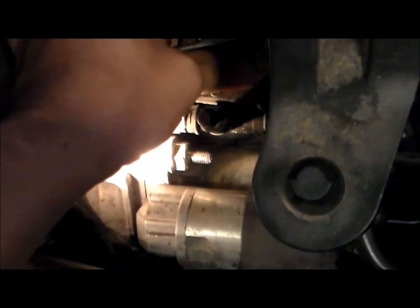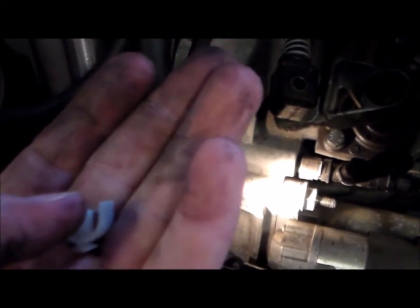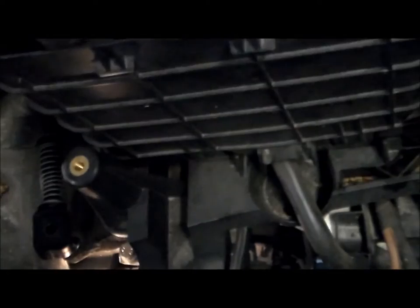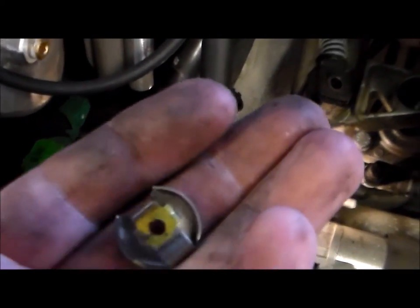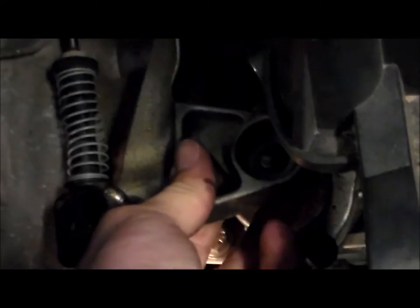So that piece sat in here like this — it was connected here and there was another tab here that had to be pulled off. This one is a little different: the hole went through and you can see the little tangs on either side that clipped onto something, so you just had to pry on each side of those very carefully — you don't want to break this. Then for the other one, all you had to do was pry up on the center tab where the yellow was and it slid out sideways. Pretty easy to get out. I popped this off, moved it over, and then had to push the linkage to the side out of the way to clear this area here, because this goes inside here. Once it was in neutral I was able to pop it up and down until it came out.